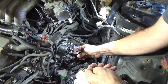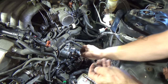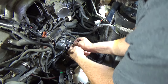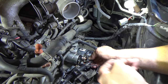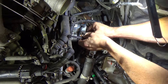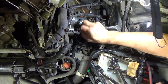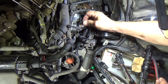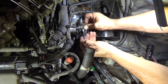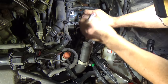That's all set - we can go ahead and screw this on. This is a little tricky because this rubber boot is kind of in the way. Slip the lock washer on and get the nut on. The rubber boot is there because this terminal is hot all the time once it's hooked to the battery. If you touch something from this terminal to ground, you're going to have a firework show. I've got it started and I'll take my 12 millimeter wrench and screw this on tight and snug.